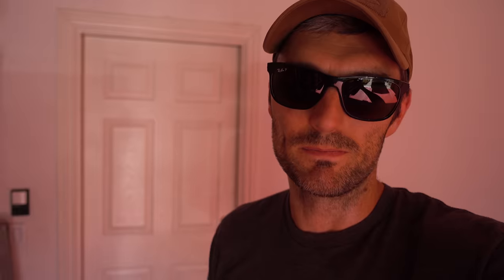I'm just concerned with the battery — I think it's probably dying, and it's probably just as simple as that. When I went to Costco, I talked to the guy and asked him: if I put this brand new battery in my truck and I realized that wasn't the problem, can I just take the battery out and return it? And he said yeah, whatever. So I have basically nothing to lose. I'm going to take my old battery out, swap this new battery in, and see if everything works. If the voltage doesn't drop all the way down to the red zone, then I'll know it was the battery. If that still happens with this brand new battery, I might be looking at a possible dual battery setup.